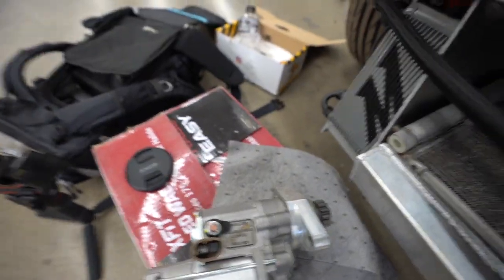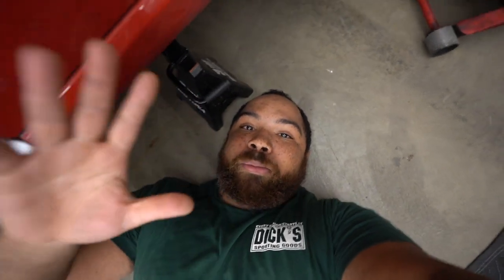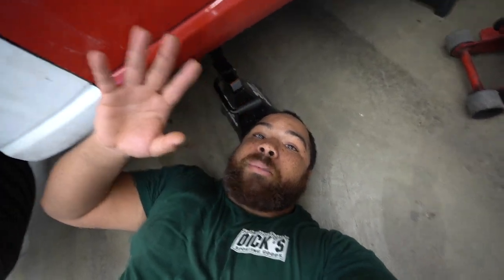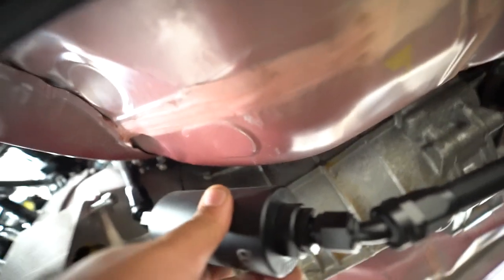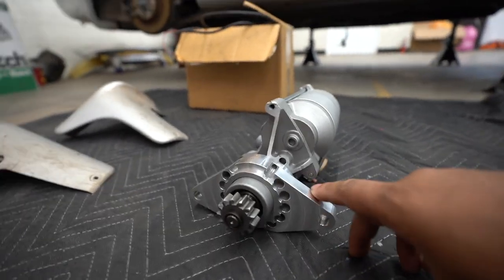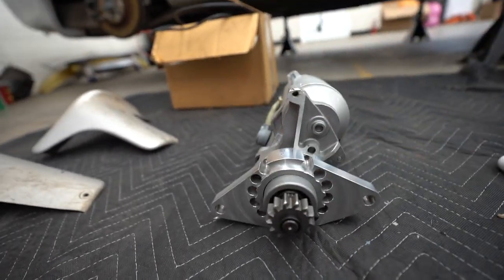Okay, so we are now going to install the starter — she's a thick one, but it'll be great. It actually goes right down there. Fish Racing made the bell housing and they made it super easy with a lot of space. I really worried about the space, but since Wasp has the adjustable top on it, I was able to orient it. There is a ton of space once the starter is mounted, though there's little room over on the firewall. Since this is adjustable and we can turn it for different mounting styles, it worked out perfectly.